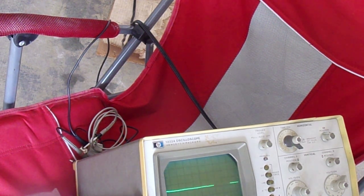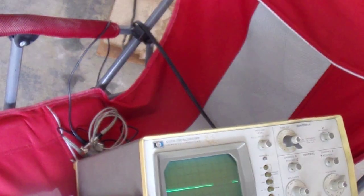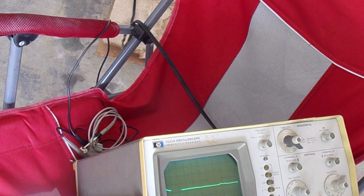So that probably accounts for why it doesn't work so well - it would if the time base wasn't so wrong. There might be something I can do about that - maybe some kind of a 555 timer or something that could actually adjust those pulses, halve them or something. But clearly that's what's going on. At least the amplitude is the same. It looks very similar - just twice as fast. So it turns on twice as often as it should.